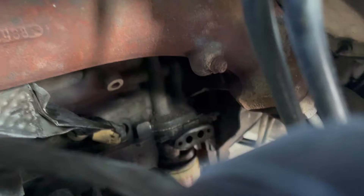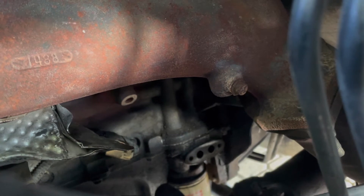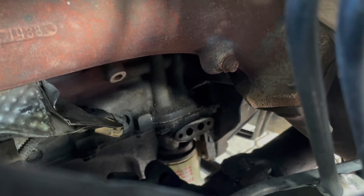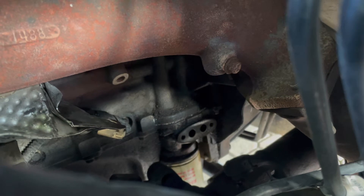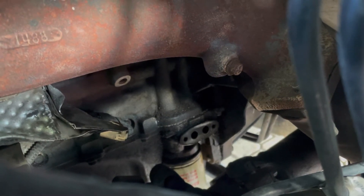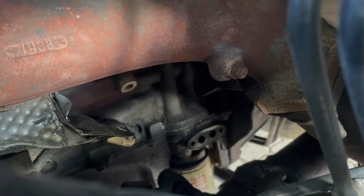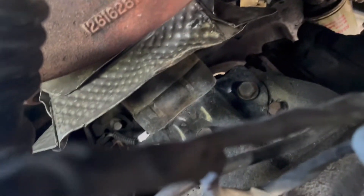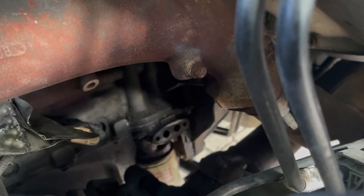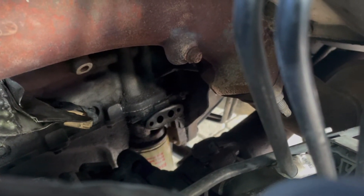There is where the leak was coming from. A tip: if your truck requires you to remove an oil cooler line, just go ahead and delete the whole oil cooler unless you really think you need it. Getting the lines out was a giant pain — plan on using a sawzall. A heavy pair of scissors can cut the rubber part of the line up toward the front, but at the back you'll need a sawzall because those lines wrap underneath the engine mount. Otherwise, not too difficult.